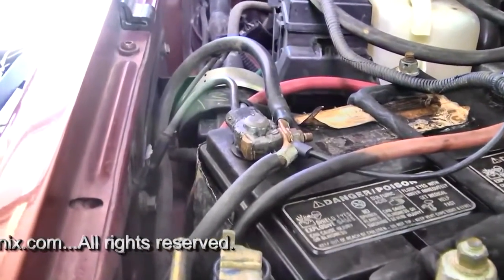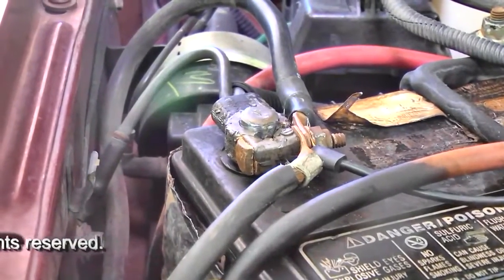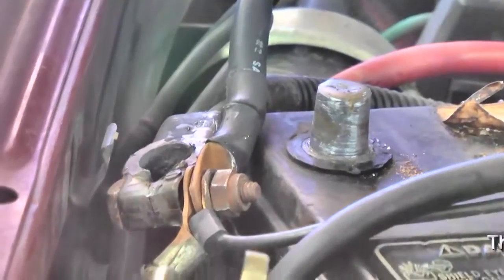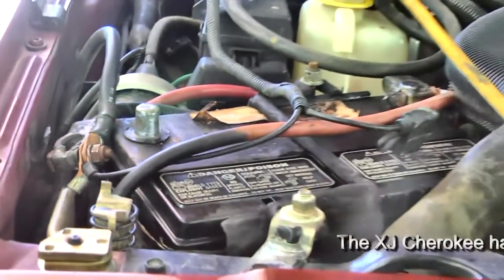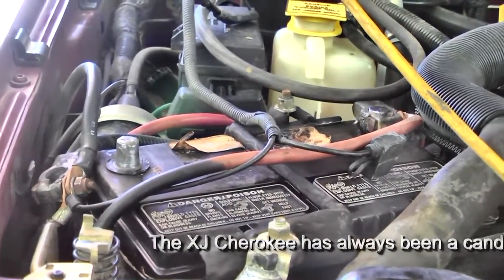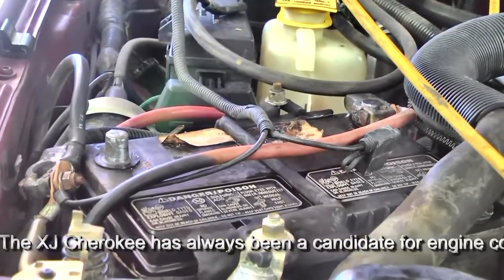At this stage, it's highly recommended that you loosen the negative battery cable, even though this will cancel your clock and your radio cassette and other things. We've loosened the negative battery cable just as a safety precaution. We're working around electrics and pulling a radiator out that has antifreeze coolant dripping from it. It's a good idea to disconnect the negative cable on the battery.